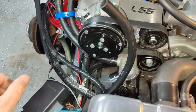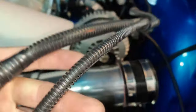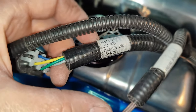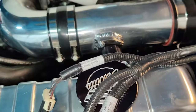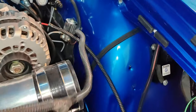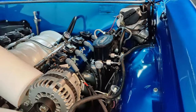We've got to get these water lines connected again. We're making a big stride — I know it seems like I'm not getting anywhere, but believe it or not, I actually am. I pulled all this out of the footwell as well — I don't need this stuff right this minute. There's a brake light connector here, and a manual shift connector, so we could do paddle shifters if we want at some point. But we don't need them right now. The only wires I really need are these three: RPM, oil pressure, and speed out. So I'll run those three wires through that bulkhead over in the corner, and this stuff can be coiled up out there — I don't need it under my feet making a big wad under the carpet.